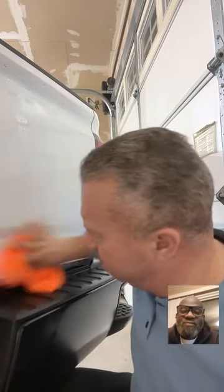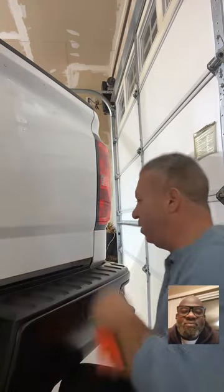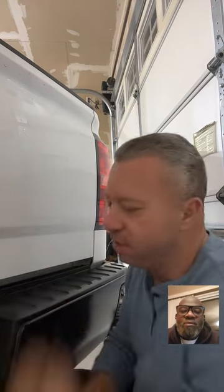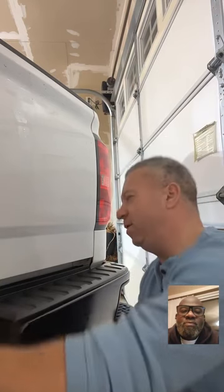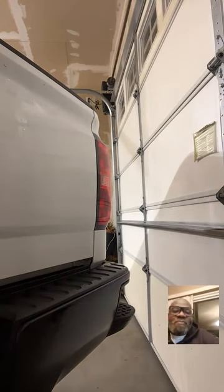Yeah, you got all your stuff there. Oh, I know. This is just a pain in the butt. One of the things you can do when you still have this stuff here is take an old Meguiar's cutting disc or blue wool pad, throw some compound on, and just buzz over that. That'll move it off. I'm going to go grab some clay to get this last little part off. Whoa. Move it up.